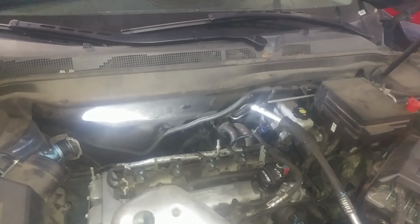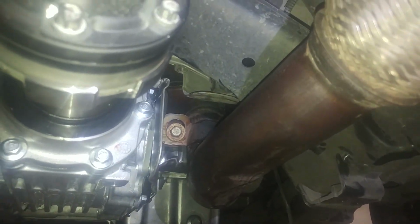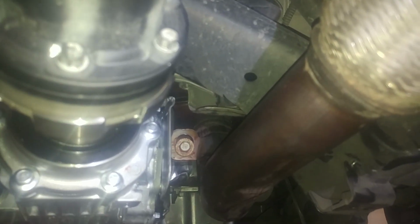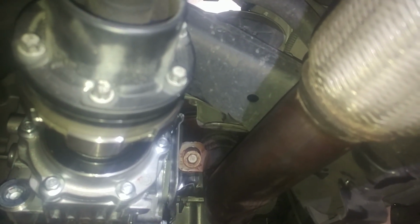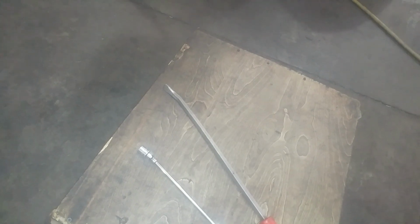So there you go. And my next tip is to make sure this bracket is installed tight before you install the 3 nuts up top tight, because this seems to have swung over to the left. I can't even get my 1/4-inch socket in there. Going with a 1/4-inch and 15mm on a swivel, and I can't even get in there. So install that with the nuts loose first on the converter.